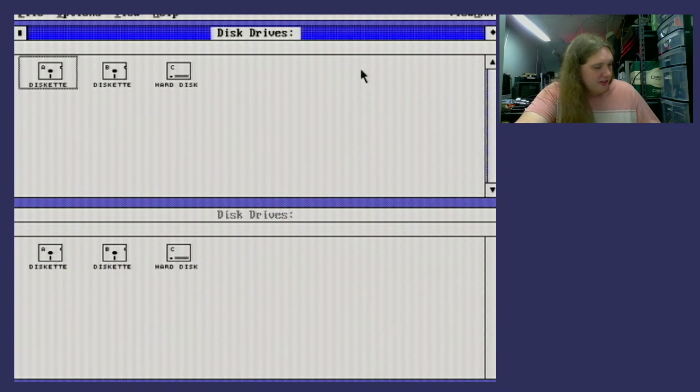For the past several years, of course this computer originally had a NiCad battery on the motherboard for the clock. It does have a real-time clock calendar. That battery naturally went bad and started leaking, so years ago I took it out and replaced it with a AA battery pack with a diode, so it wouldn't attempt to charge the batteries, and I just put standard carbon zinc batteries in it, and that's how I used this computer for years.